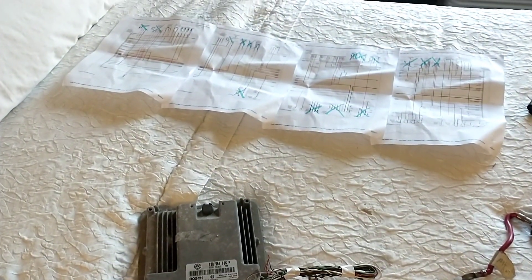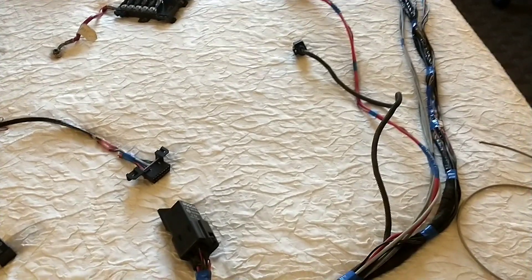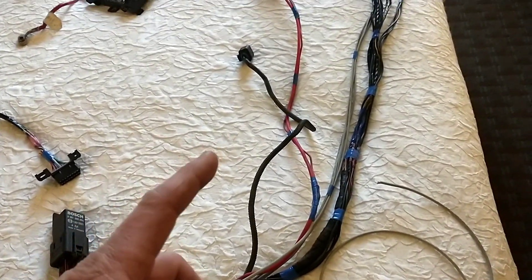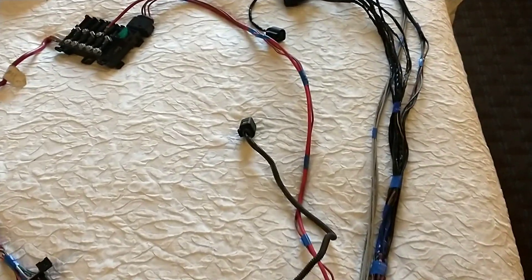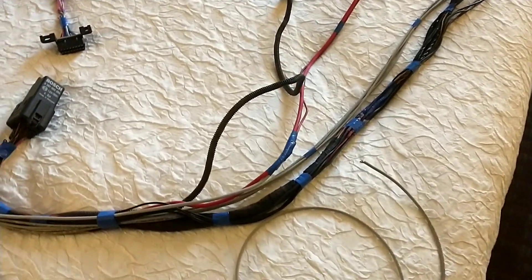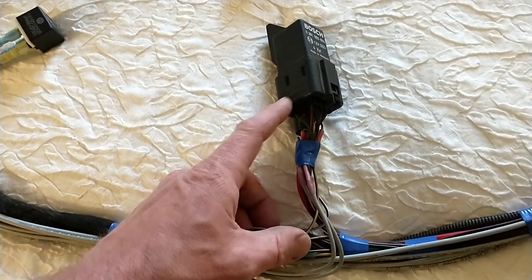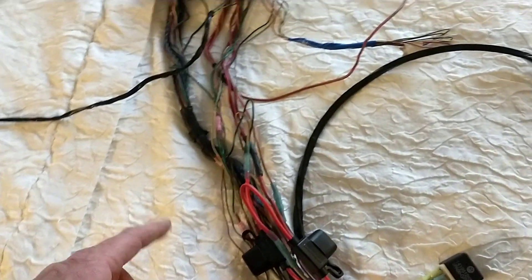All the sensors are pretty much straight to the ECU. You're going to have a couple of power wires though — specifically, I run a power wire out to the alternator, that's all it needs. Then your N75's yellow/black will also get power, and then there's another yellow/black that goes to the glow plug relay, so you're going to need to jumper all of those together and send them up to where you tee into power.